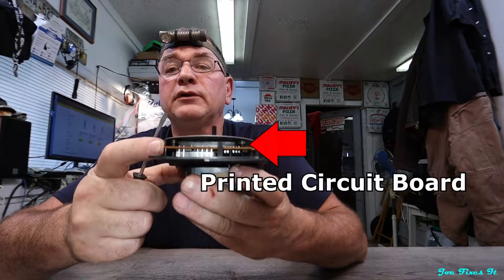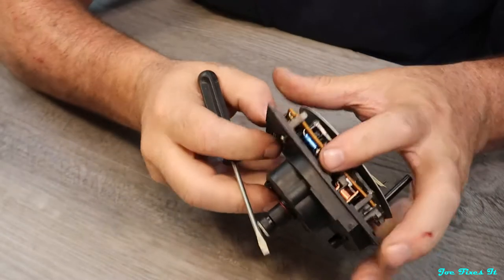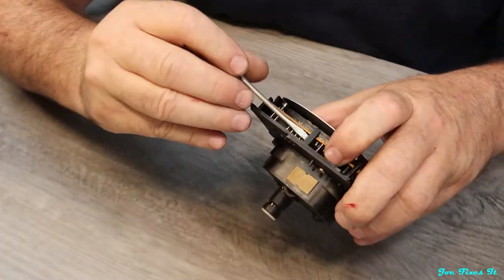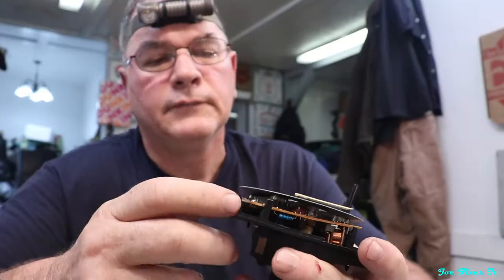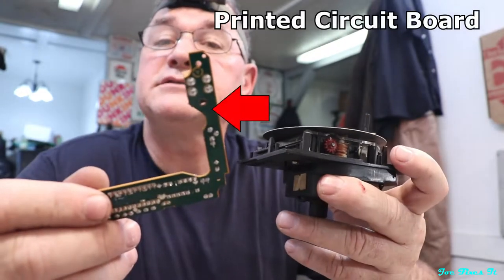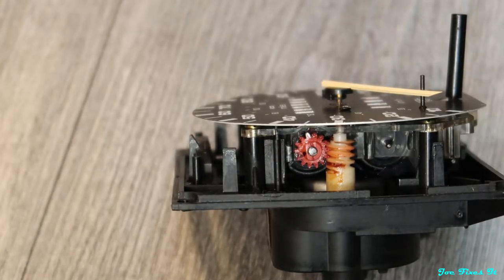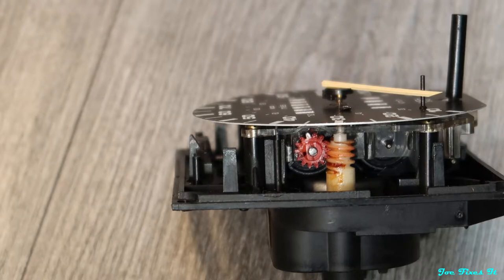We've tested it — there's nothing wrong with the plastic gear on this one; it's stuck down to the shaft pretty good. It's not actually a very hard fix. You don't have to dismantle the speedometer all the way. To get easy access to that plastic gear, you pull this little printed circuit board out of the way. It has four plastic tabs — just pull on each tab a little bit and pop it loose, working your way around. Don't break the tabs or you're in trouble. Once the circuit board is out, you have easy access to the little red speedometer drive gear. You can get a screwdriver, pry it off, and slide a brand new one right on.